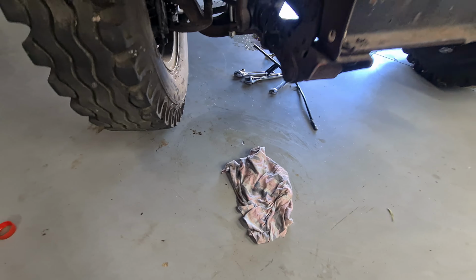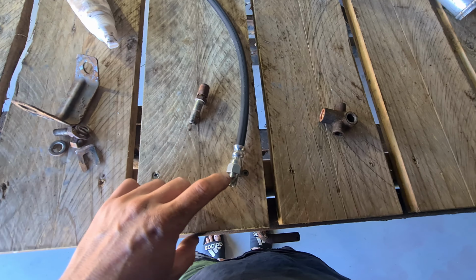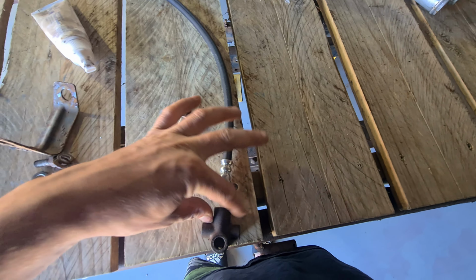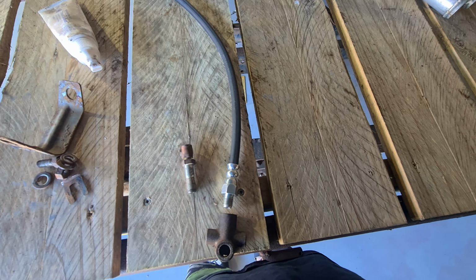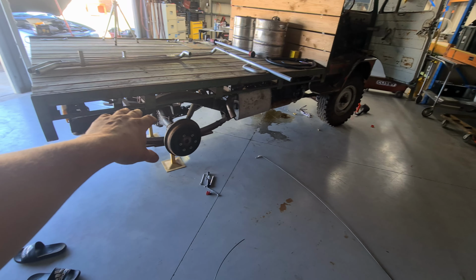Alright, now they've got this new brake line, which is awesome. Chuck a copper washer on here and chuck it back into the T-junction, chuck the breather back in and chuck it all back on the diff. Alright, this is going to be interesting. So I've got the new rubber line onto the chassis, so it goes diff to chassis. All the diffs all buttoned up.